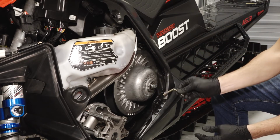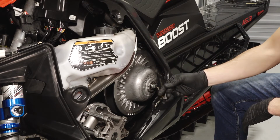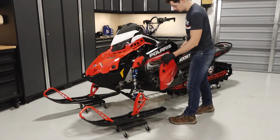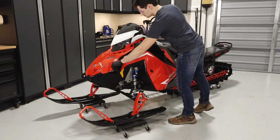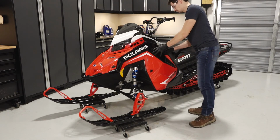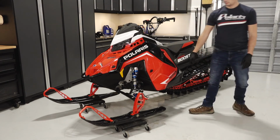Reconnect the side panel trim and reinstall the spreader tool. Next, reinstall the side panel by inserting the upper tab and pivoting in to engage the lower tab. Finally, latch the 3/4 turn latches to secure the panel.